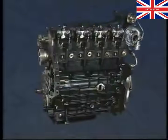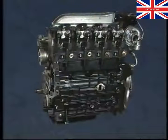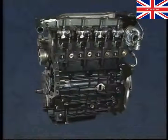A 2-piece cast iron exhaust manifold houses the turbocharger and is sealed to the cylinder heads with separate gaskets. The alloy intake manifold also uses separate gaskets. A special manifold, which also houses the cooling system thermostat, carries the return flow of coolant from the cylinder heads.